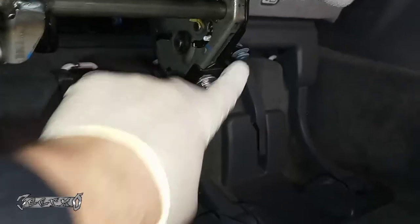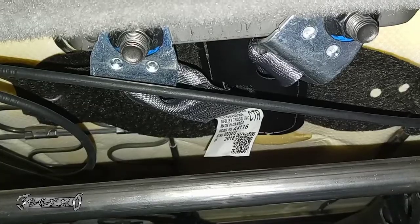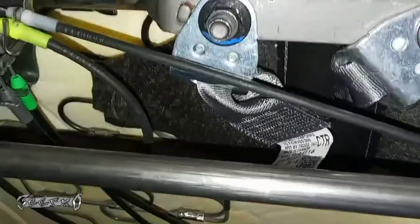I'm pretty sure you can get to the nuts without removing the panel, but if you do take it off, it has clips so make sure you don't lose the clips. Underneath here — I'm gonna try to get a better shot — these are the nuts for the seat belt. If you just take these nuts off, both those seat belt buckles will come out.